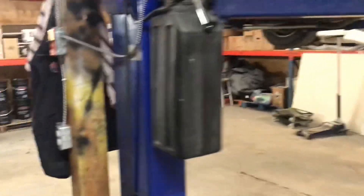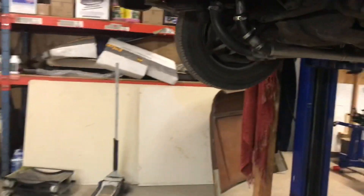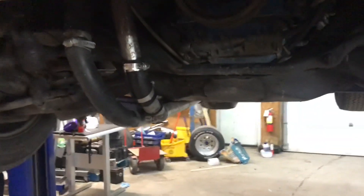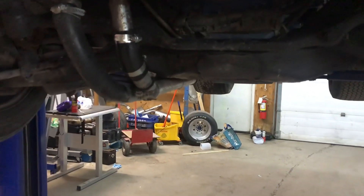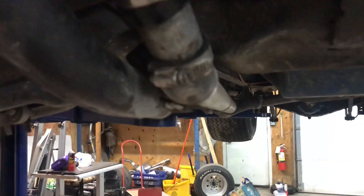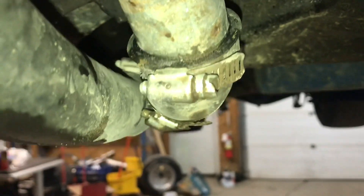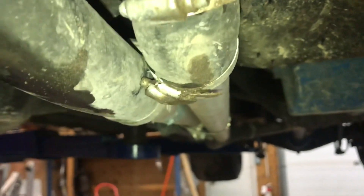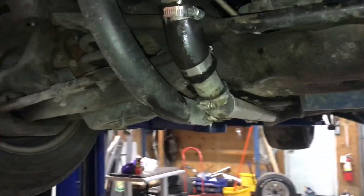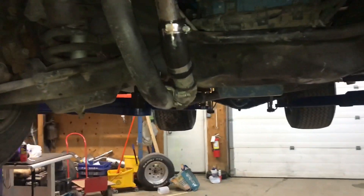So what we have today — I'm going to come around the front and show you. I'm going to relocate my radiator hoses, because they are well below my crossmember. Here are my radiator hoses, about two inches down. I have a problem with my hoses scraping off the road. This clamp used to look like this clamp, but it's been getting a little personal with the road. I can hear some scraping when I'm going down the road, and when that wears through enough it's just going to go bang and empty everything all over the road.